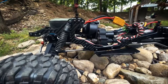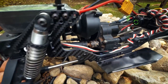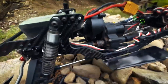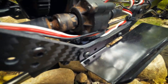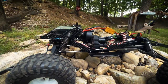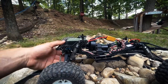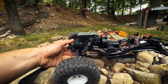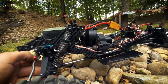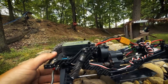Being that the front was so short and this has an angled skid on it, I was having issues with, during compression, the spur gear actually hitting the drive shaft. You can barely see it down in there, but I put some spacers on the front bolts or the transmission mounts to the skid to kind of angle the front up and level it out. And I think I've got it to where it's clearing completely. And I went ahead and put the spur cover back on there. I had to cut it out just so that it wasn't hitting the drive shaft as well. But I think I got that resolved.